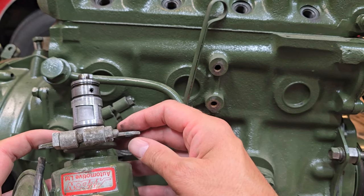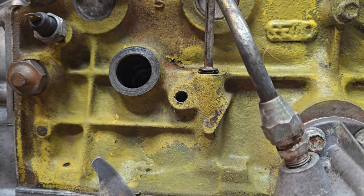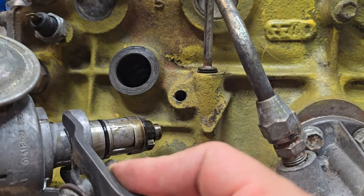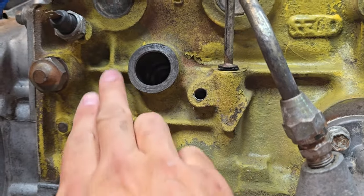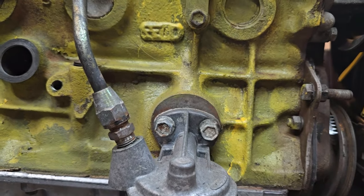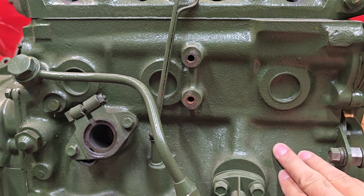The A-plus motor is different. Here's the A-plus motor — it uses this style of clamp to hold down the distributor, and the flange here is different, so the clamp goes over the top like that to hold it down. Also in view are the extra ribs that were cast into this block for reinforcement. You can see them particularly over in this region as well, and they're also on the back side.